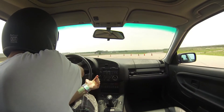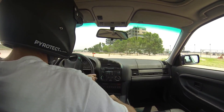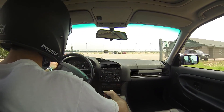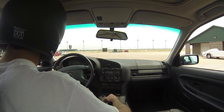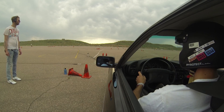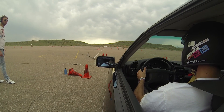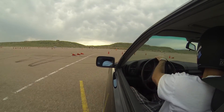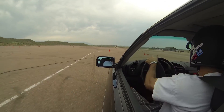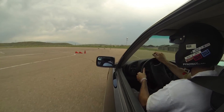The car was working really good. I haven't driven a car of this prep level. Most of my cars are stock class cars, consisting of basically tires, alignment, upgraded shocks, and maybe a front sway bar. This car, with the giant tires — the tires are 255s wide on the 17x9 wheels — and with the suspension and the camber I got, it had a whole lot of grip. So it was easy to drive, fun to drive, and it turned out to be really competitive for the BMW Club D Street class that I was running it in.